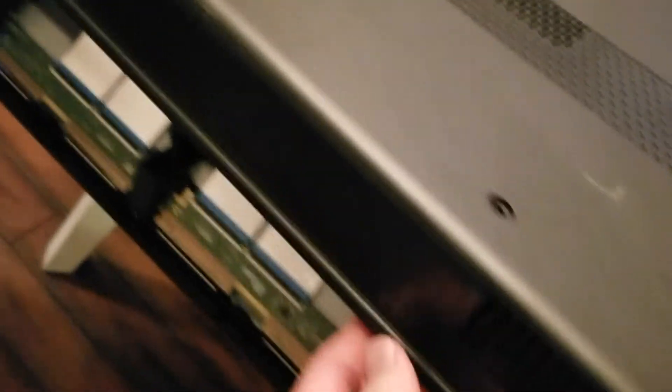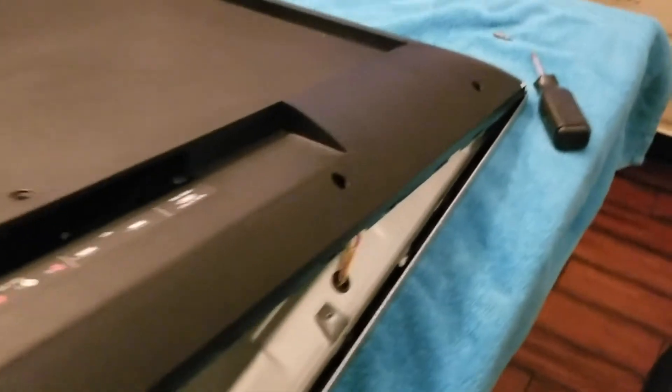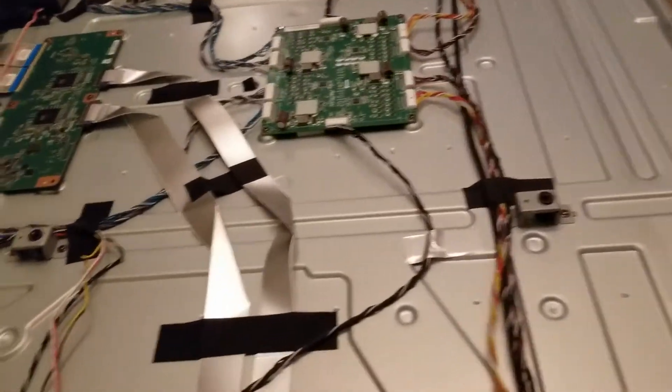This corner came up really easily but this one needed a little bit of prying. This plastic is really thin and could break very easily — it's held in by some clips so just don't go ripping it. Once you have it loosened you can see there's a wire that goes from here all the way down to the main board, which is one of those reasons you don't want to yank this thing directly off. We're going to disconnect that — there's a little clip on the main board that just pops right out — and then take off the back piece.